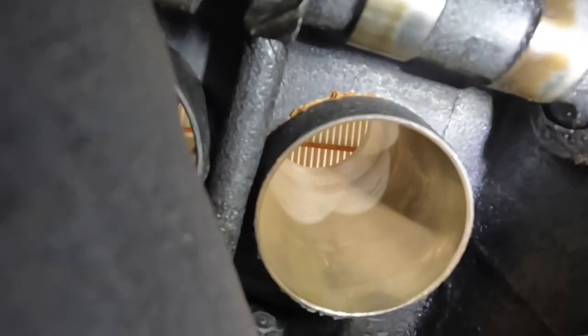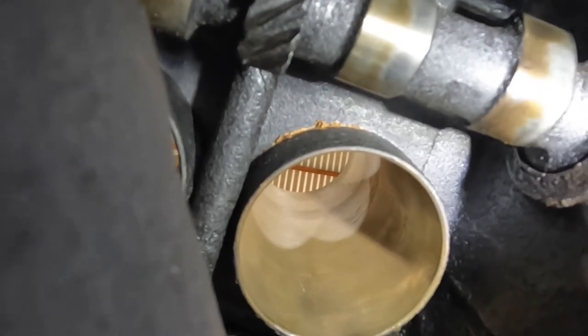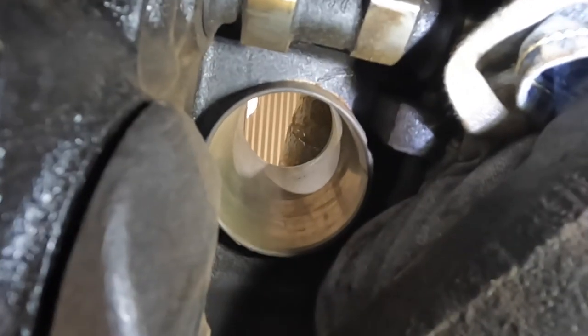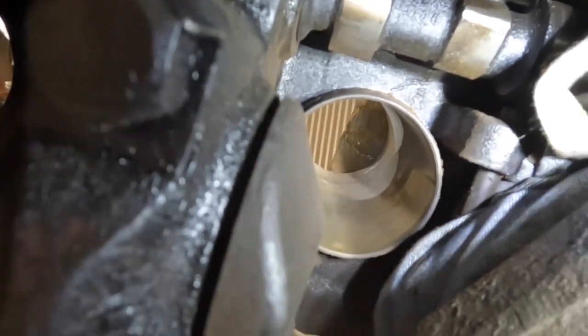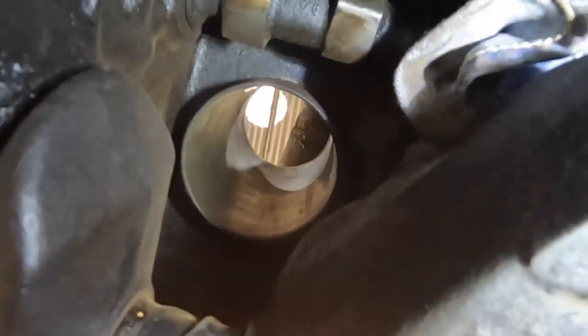You can see it a little bit more clearly just up there next to the camshaft. Normally to get these out, you get a block of wood and just tap them on the bottom. But these ones are well and truly rusted in, so we can't just tap them out — we need a puller to pull them out. I'll take you back up the top and show you the puller that I made up.